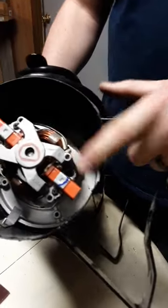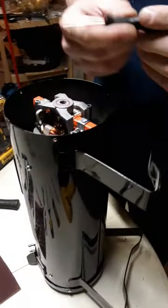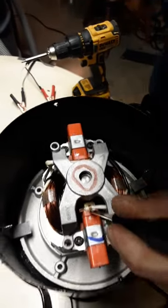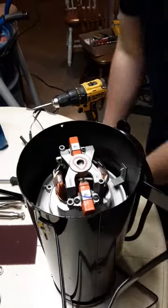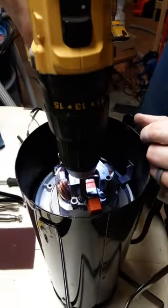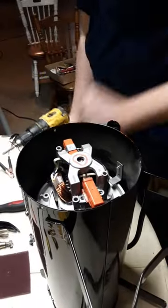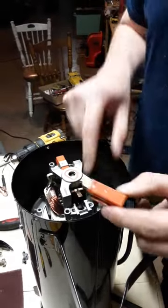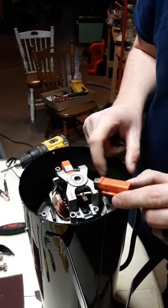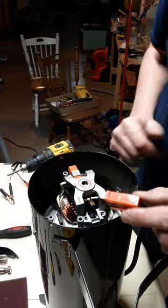On the exhaust side, you'll be able to see the motor facing towards you, so the brushes are there. We're going to pop this brush off and check the life on it — you'll need the little screwdriver and a hammer. Get your screwdriver behind this little brass tab and lightly tap it out until it pops out. Then there are two little screws that strap the brush in — take those out and that brush will pop right out. If you take the strap out first and try to take this little tab out second, you'll more than likely break that tab. So make sure you pop that tab out first, then take the strap off second.